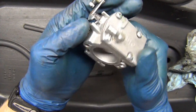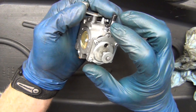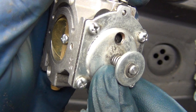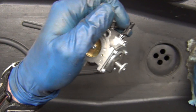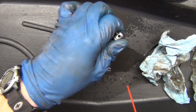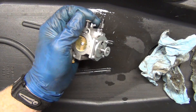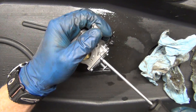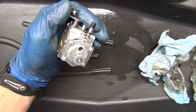Now this looks new but it's not. All the springs were full of garbage. When you get garbage all over the outside of the carburetor it makes it hard to keep it clean. I've still got a little bit of crud here so let's wipe that off. But basically anywhere there's a spring, anywhere there's a nook or cranny, you're going to find sand. Sand and grime on the outside or on your gloves doesn't matter, but your gloves are going to be touching tiny little parts on the inside and that sand can wreak havoc if it gets inside the carburetor. That's why there's so many strainers and things to keep things clean.